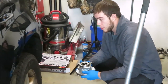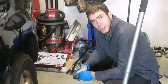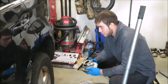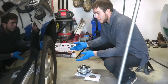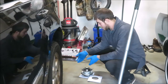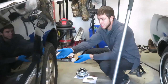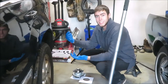Pretty good, especially being up here in New England. This is probably the original wheel bearing — we'll find out when we take it out, right? If it's not stamped with the Chrysler logo. But besides that, it's fairly simple. This is pretty much what any other vehicle looks like, just different sizes of what's coming off. You got to take the tire off, take off the caliper, take the rotor off, and there's the four bolts in the back. It's pretty self-explanatory, so let's get right to it.